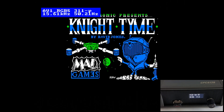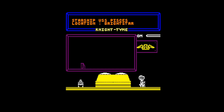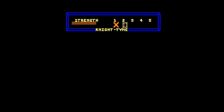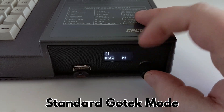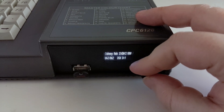As the disk drive emulates a real floppy drive, the access speeds will be the same as the original speeds - at least it's faster than loading by cassette tape. When not using the HXC compatibility mode you have full access to the USB stick and can navigate through the folders and files. Simply select an image and it will mount it ready for use.